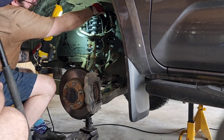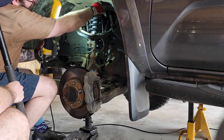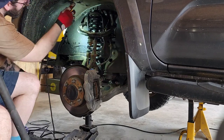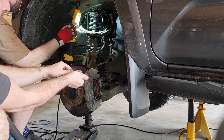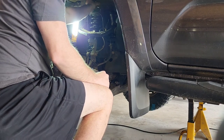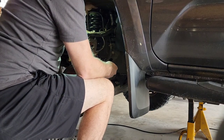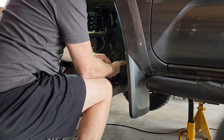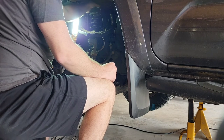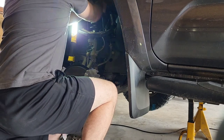So now we're basically just compressing the spring using the jack on the lower control arm, rather than go through the dangers of a spring compressor — this is a little bit safer. Now here's the mounting hardware: you've got your washer and your bushing. It goes bushing first and then the washer on top — squeeze it down. Make sure the washer is angled downwards like a conical washer — it has a bit of a concave face. Make a sandwich and then I'm going to start putting the lower control arm bolts in again.